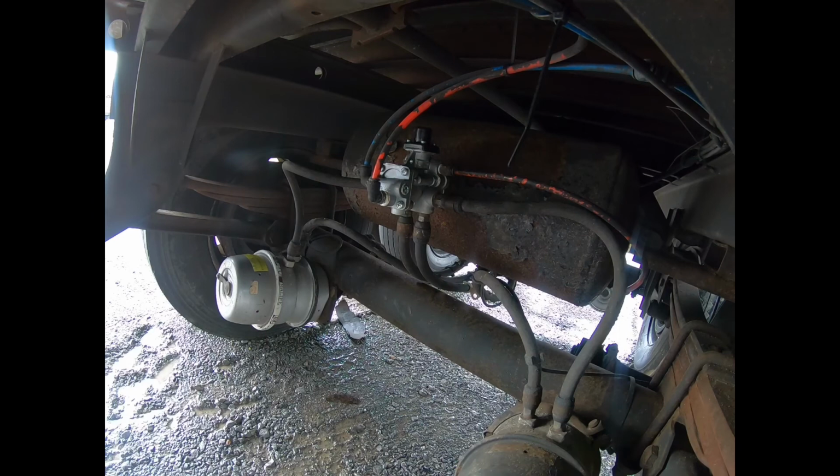That's what we wanted. Now just fill up with air, make sure we don't have any leaks going anywhere. I don't stock these on my truck because it's not a very common thing, but at the same time, when the brakes don't release, if they're not just frozen from cold weather, this is the most likely culprit, unless you're just getting no supply. I test them off my truck compressor to rule out, and a lot of times it's a drop trailer. This was originally a drop trailer, but now it's got a driver with it. So, we are looking good.